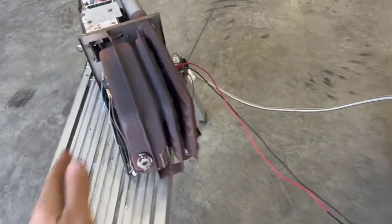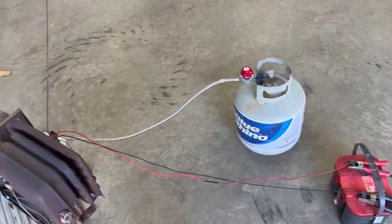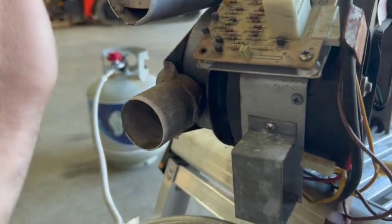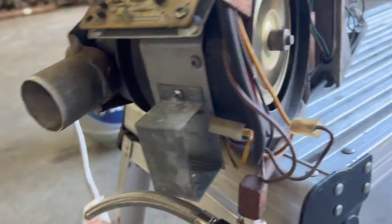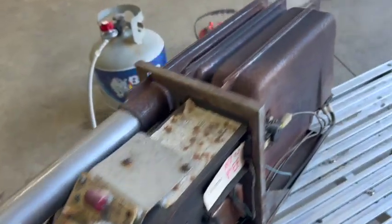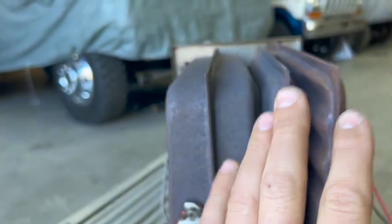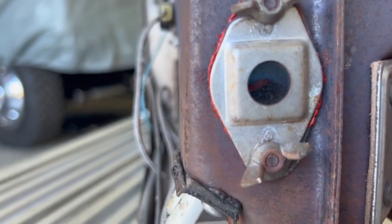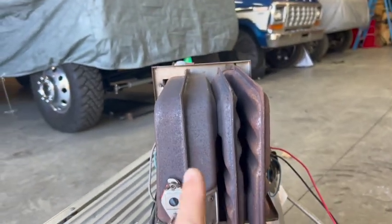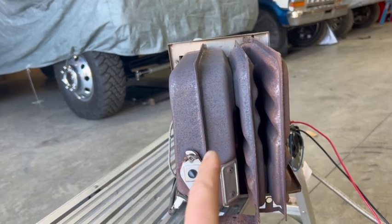She's up and running — she's hot! Don't mind all this, it's perfectly OSHA approved, not a fire hazard whatsoever. Here's my exhaust and my intake. What I did was bypass that little gas valve and ran the gas directly to the chamber, then just used the valve on my regulator for turning it on and off. You can see the flame in there — she's blowing off some good heat. I just ordered the valve, it should be in within a couple days. I'll put that valve on and this will be checked off — I can put it back in and it'll be ready to use.